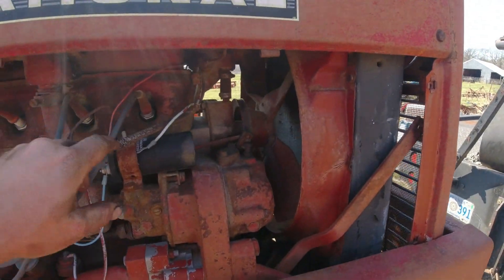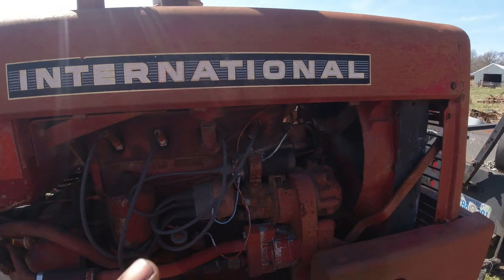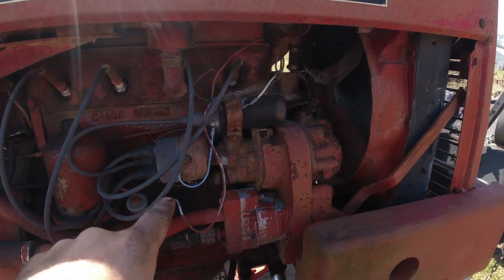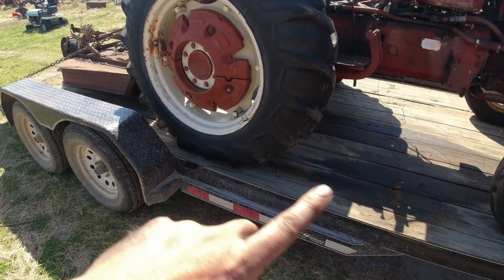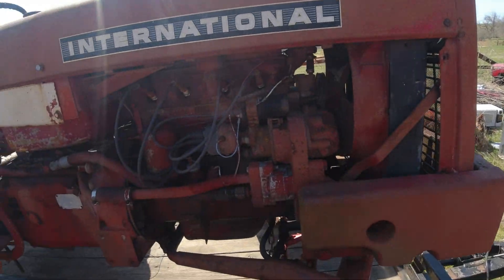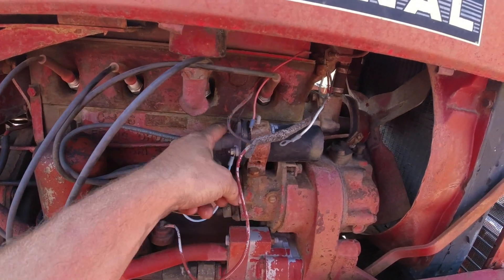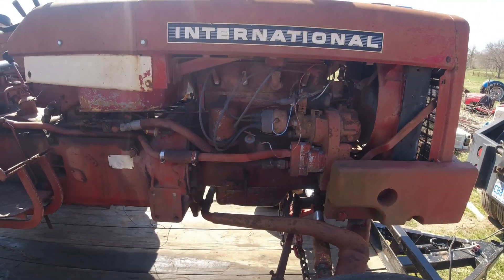This coil too, and the external resistor — that's gone, I done ordered one. Lo and behold I found one inside, so I'm going to make this all one video. I'm going to put a very basic wiring system — just hook the coil up and hot-wire the battery for now to get it off my trailer. The way you do these, if anybody doesn't know, you hook this side back to your distributor and go from the hot side of the coil to the hot side of the battery. It's 12 volt.